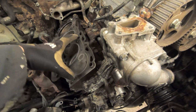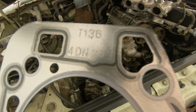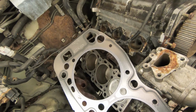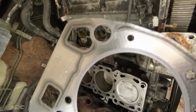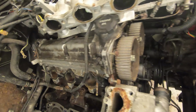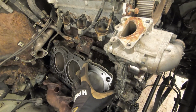I was a little confused about how these head gaskets go on because in the factory service manual, it says the markings go up and to the front of the engine, but they only have one part number, which means you have to spin this thing around since the heads have reverse cooling ports on them. So this has the cooling ports on the back, and that side has them on the front. So you just have to put it like this,